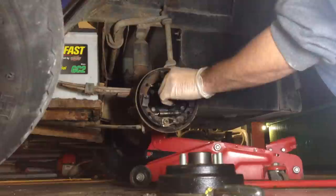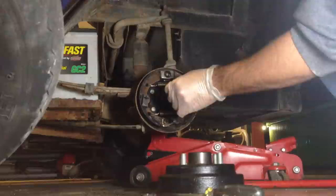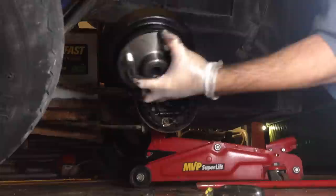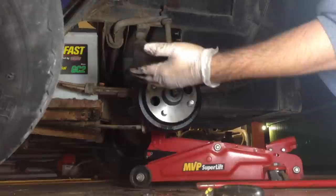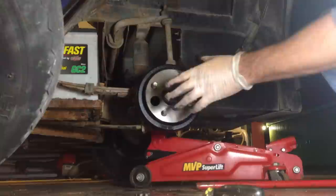In this case we have a stripped hub. The driveshaft has a male spline gear and the hub has a female spline gear. What happens is the spline gear inside the hub gets worn out — the teeth wear out — so the actual wheel won't spin. You'll give the golf cart gas, you'll hear the motor running and spinning, but your tire won't move. If you remove your cover and cap and look, you'll see the castle nut and everything spinning but your tire won't. If you have that problem, you most likely need a new hub because it's stripped out.